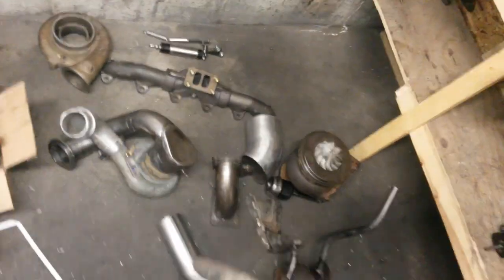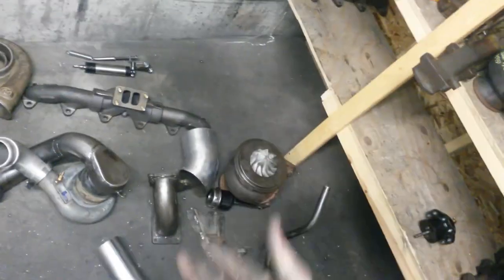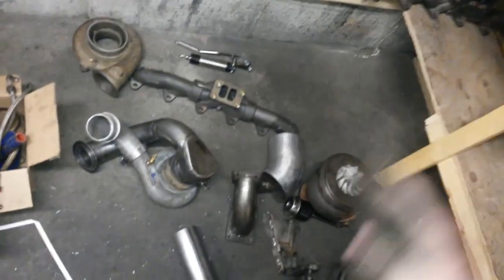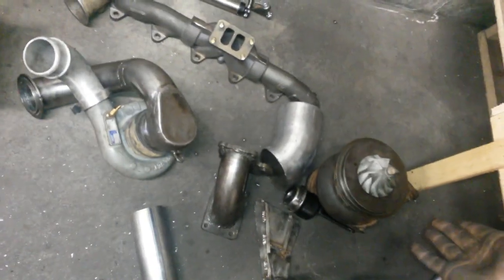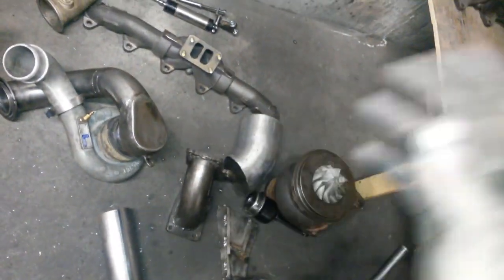On compounds, I don't think you really want that. I think you want kind of a fade control, because with that, the small turbo would try to do everything, and all of a sudden, bam, big turbo, come help me. Whereas with a more gradual opening, like if I were just to adjust the wastegate actuator by threading out the rod, the HX35 would be able to slowly give over control to the big turbo, which should be a little more smooth and seamless. That way it's not like a big power surge or something.